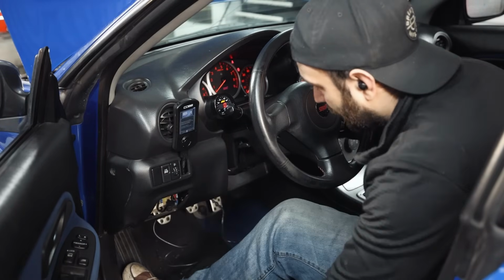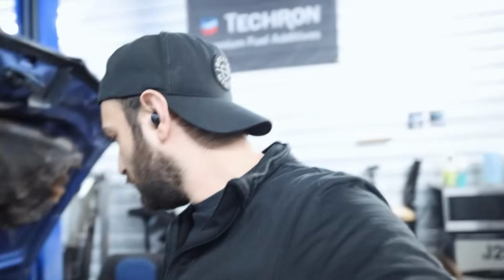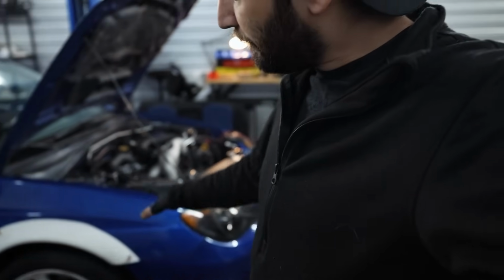So we have our Access Port married. I made a small list of everything I need to order to get this car running. I'm kind of limited to what I can do in the engine bay now, which is weird. So instead, we're gonna jump up to the suspension. I do want to figure out where we're gonna have the front suspension sitting. I need to hook up the tie rod to the knuckles, so that the steering wheel actually turns the wheels. And then we're gonna lower this thing down a little bit in the front just to get our ride height where we want it with the flares, because I want this thing looking mint.